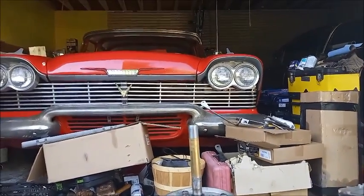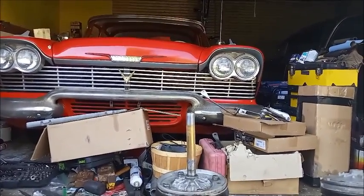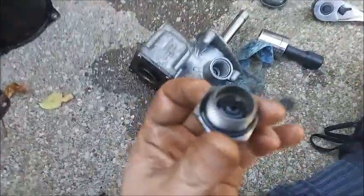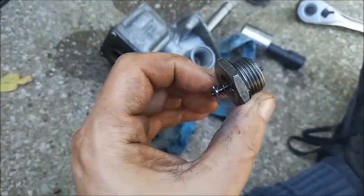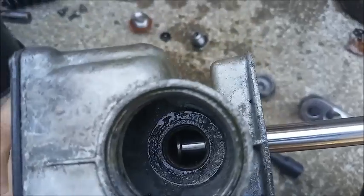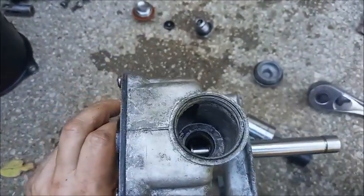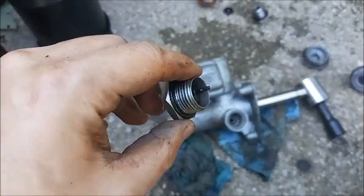The Delco Moraine has small holes at the end of the plunger, which get blocked by the primary seal when the brakes are being applied to accomplish the same thing. Compensating valve removed. You can see that it's open like this. And you can see inside the master cylinder where the ridge on the base of the plunger pulls the stem of the compensating valve.